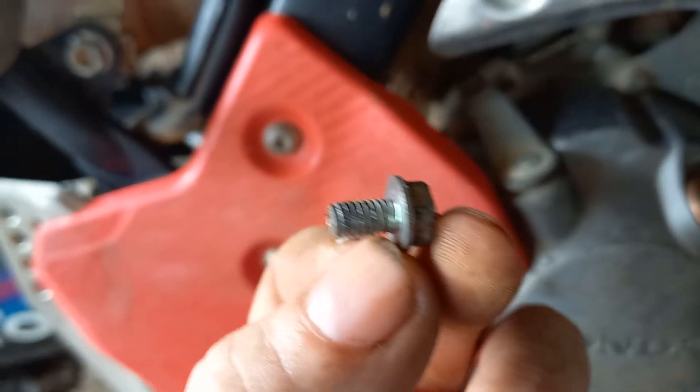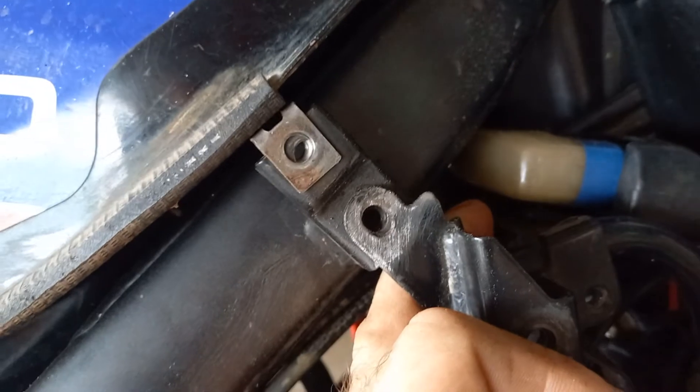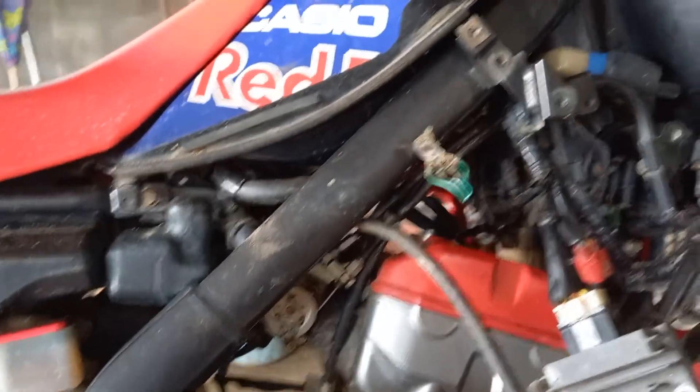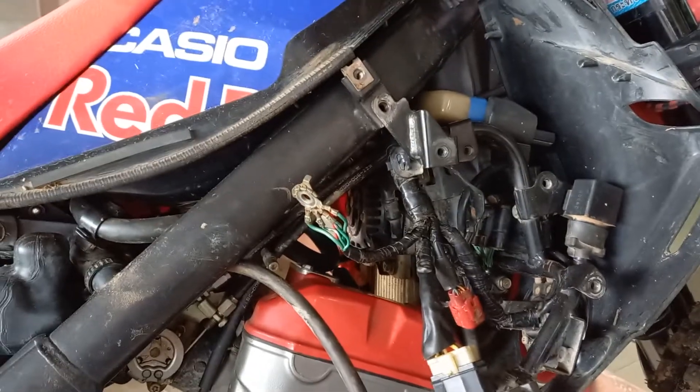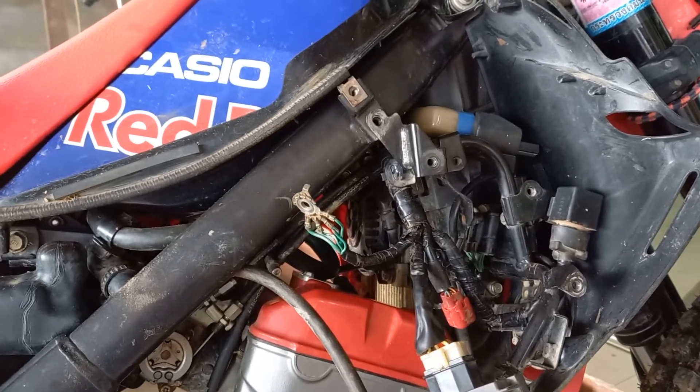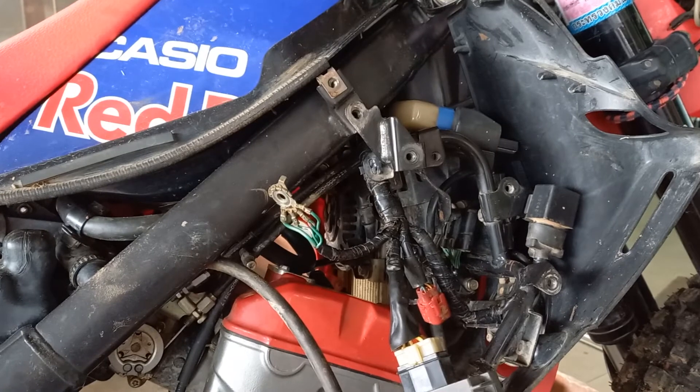But nay — that might not be enough. So what we're gonna do is have that frame tube piece off again, sand in behind there between the two mating surfaces, sand that down flat and clean, and have a good scrub around on that bolt, then put it all back together and see what's happening. So if you're having problems with your bike cranking over and you go and change the battery and still have problems, that's what you might need to look for.